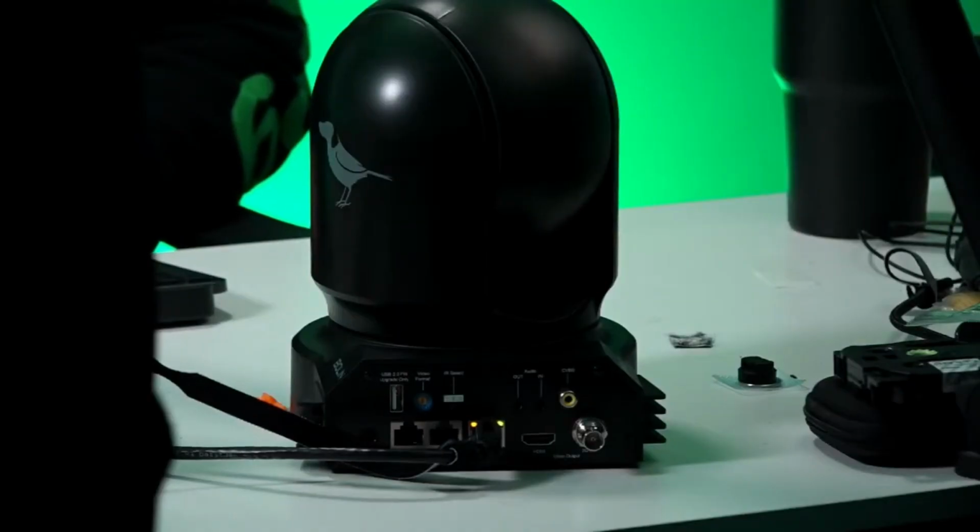Okay, so if you use NDI control, you can just run one Ethernet cable, Cat5e or Cat6 of some category. Please do not do Cat7 or anything else right now. Cat5e, Cat6, and so on. These cameras are designed for a one cable install, and that is exactly what we're seeing here. Okay, I have control, I have metadata, I have video, I have everything coming into my vMix studio over one cable. And so it's incredibly convenient.